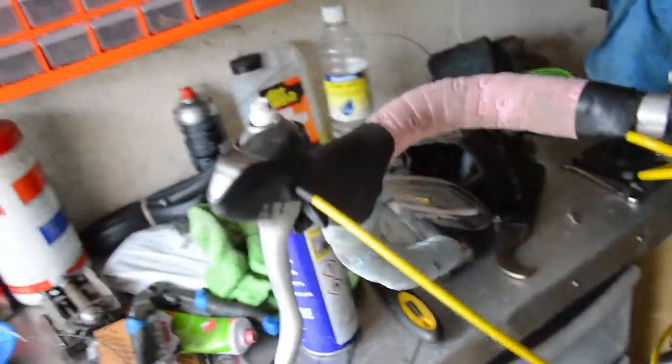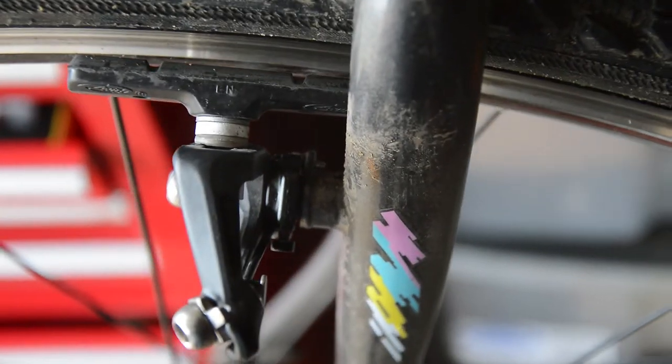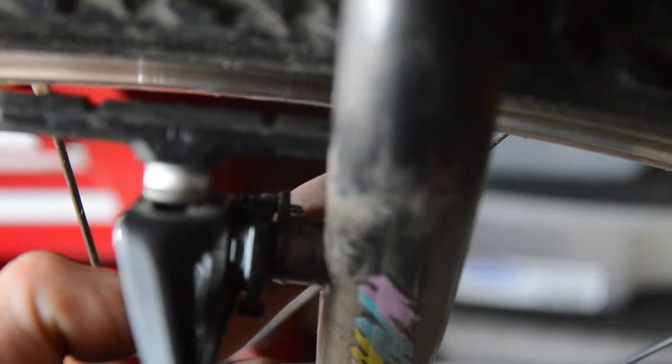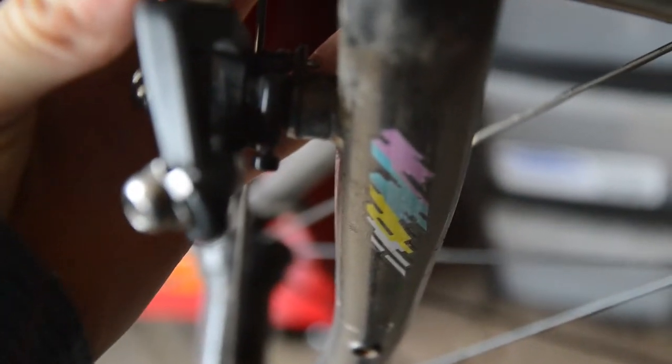Brakes are on. On the front I've got loads of nice spring tension. There's a little bracket at the back - you can just about see where my finger is - there's a point sticking through with three holes for it to slip into. I've adjusted it so I've got maximum tension on that, so when I release the brakes it pulls them back out automatically.